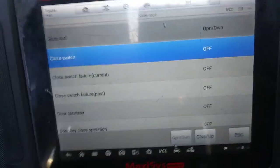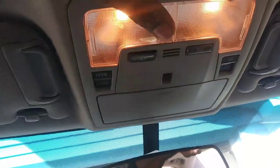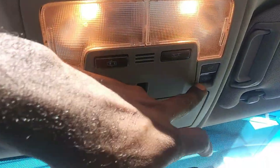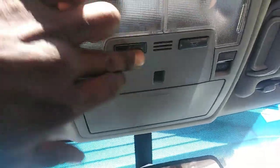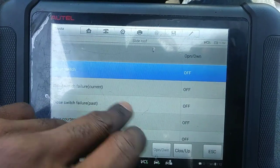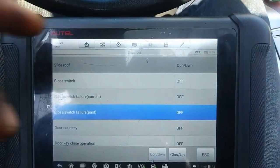We see it reflecting in the computer, but for some strange reason the other one's not reflecting. If you have a power problem and you don't have any type of power source and you don't have a bidirectional scan tool to monitor the data, you may have a power problem — especially if the lights aren't working and you have no function with the up or down feature. You want to check the power source if you have no operation of this unit. But being that we have operation here, we can command it and close it with the switch manually — the switch is just bad.